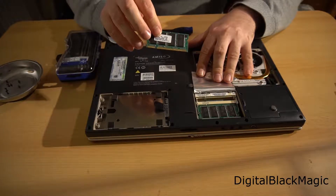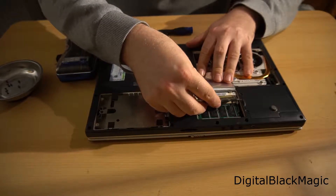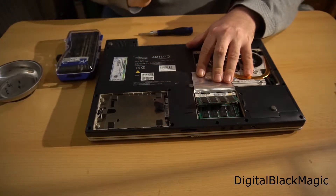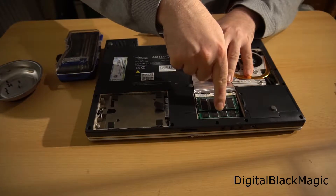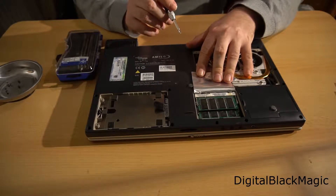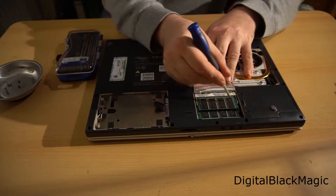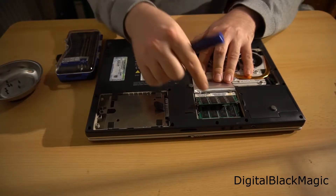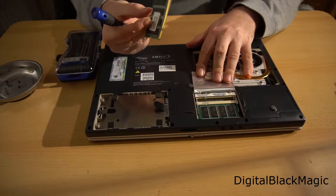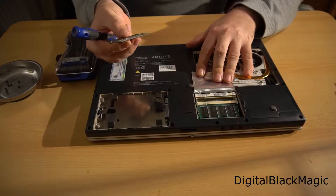This makes a total capacity of 512 megabytes, which is way too low for current systems and was never a big thing — not even for Windows XP. To reseat the module, you just put it in the socket and gently push down until it locks in place. This procedure hasn't changed much for current systems; the only thing that changed is the socket itself, to prevent you from installing the wrong modules. Many laptops today have soldered-on memory, so unfortunately you can't swap that.